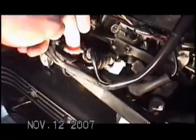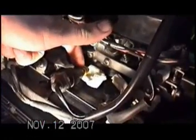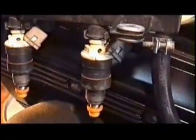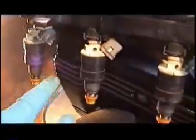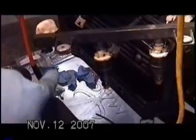Those pop right out. Then you're going to spray a little bit of silicone in there, work it back and forth, and pull your injector out. Each injector is made of metal, so they're pretty solid. For the six O-rings, they're all the same. At the auto store you can use a fuel injection plug puller to help get those out. Getting them out, I take each clip off and am able to just pull it off with my glove. I do them one at a time so you don't mix stuff up.